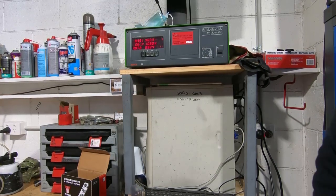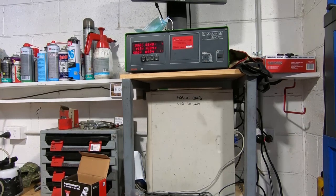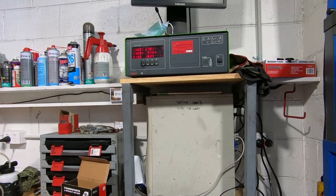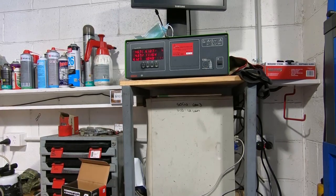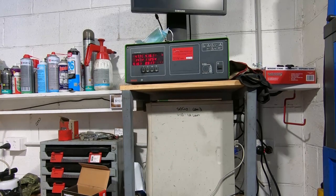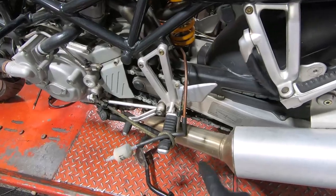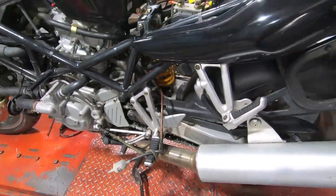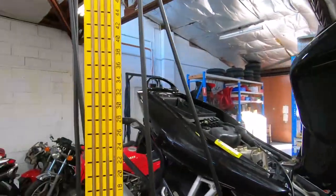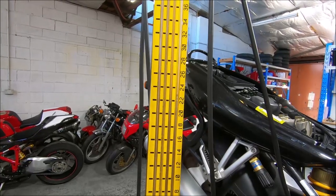We'll just check the horizontal again. Back to the horizontal. About 4% still. So that should be nice. And we'll have a look at the balance gauges, but I think we'll probably have pulled the vertical vacuum down a little bit. Having wound the air bleed out, it reduces the vacuum. And so they'll probably be pretty close to the same on both cylinders now. So that's the vertical mixture takeoff out of the header. And look at the vacuum now, a bit of air in it, but changing the air bleed settings hasn't made much difference at all to the vacuum gauge reading.